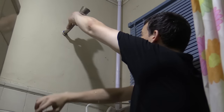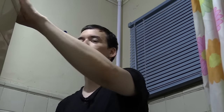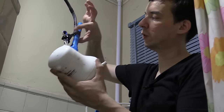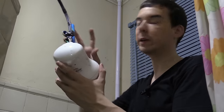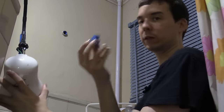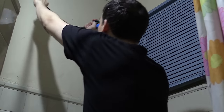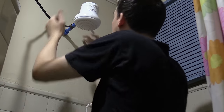Here we are in the shower. Let's remove the old one — got a little bit wet there. Out comes the old one; you can see it's a very simple fixture. I don't have a hot water system or anything like that. I've wrapped some tape around the connection blocks and put some tape around here to provide strain relief. Next thing is to just screw this little adapter into the wall and push-fit this into place — there we go, it's ready to test. Before you connect it for the first time they recommend you run water through it first.